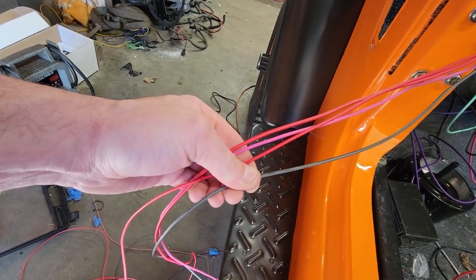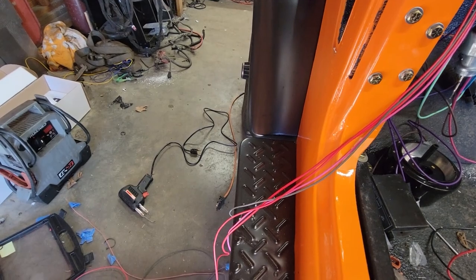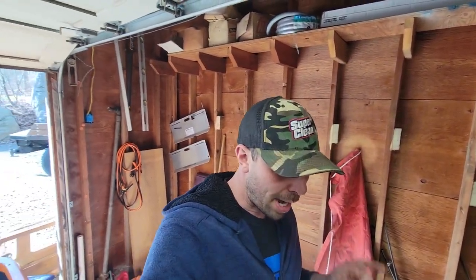And then fan power, only because we're going to wire up the fans individually and not use spots in the bulkhead for that, because we have fan triggers coming out of the ECU, which is already in the engine bay right there. And I believe earlier in this video, I mentioned that these wires are convenient and you should always just coil them up in a loop and put them under the dash, because you never know when you want to use those circuits.